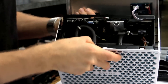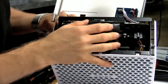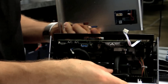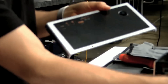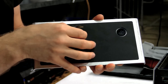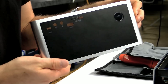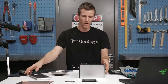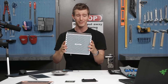This gives us a pretty good look at the front panel. There's a little power PCB that plugs into four wires — that's your front switch as well as your front power LED, since the LED is built into the switch. Everything else is just an aluminum cutout. This is a solid aluminum piece, and this black part here is a plastic insert that appears to be glued on to give it an accented look at the front. If I was going to have one of these in my living room I'd probably want to paint it — some kind of more performance-looking finish. It is a $1,600 US bare-bones machine.